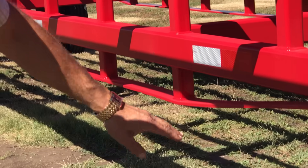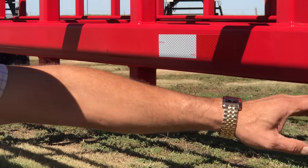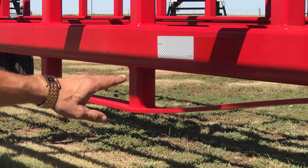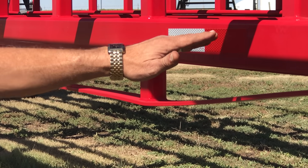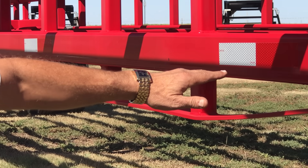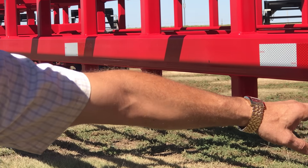Right back here, there's a lot of length from the hitch to the axle, so we used a bridge truss strap underneath our main frame. It takes the sag out of the belly of this trailer. It doesn't flex much at all when it's loaded — just a little bit of weight here tremendously increased the strength of the trailer.